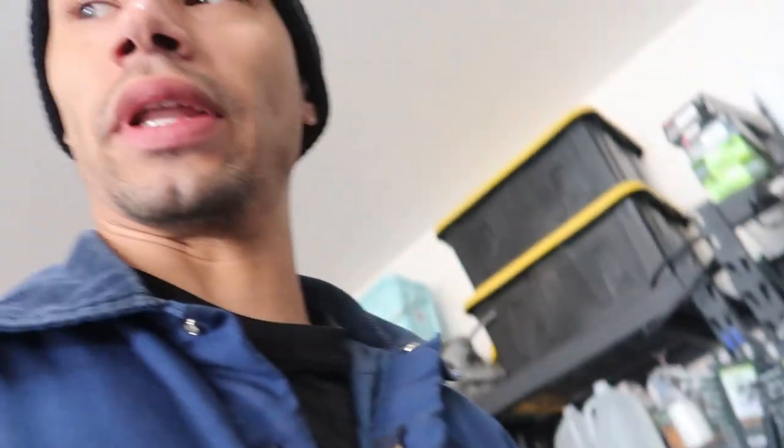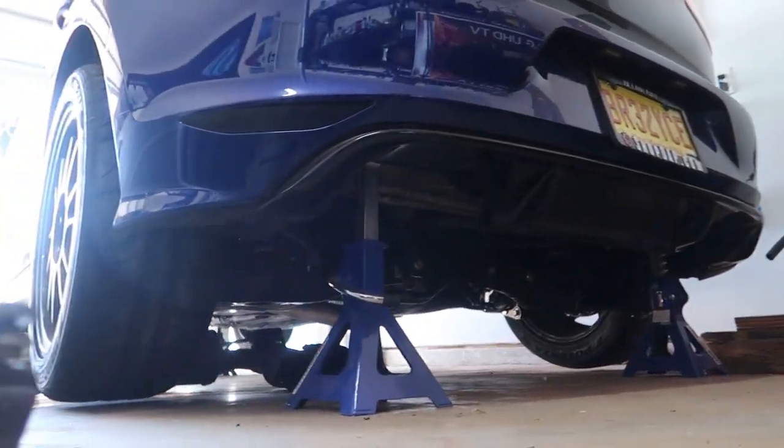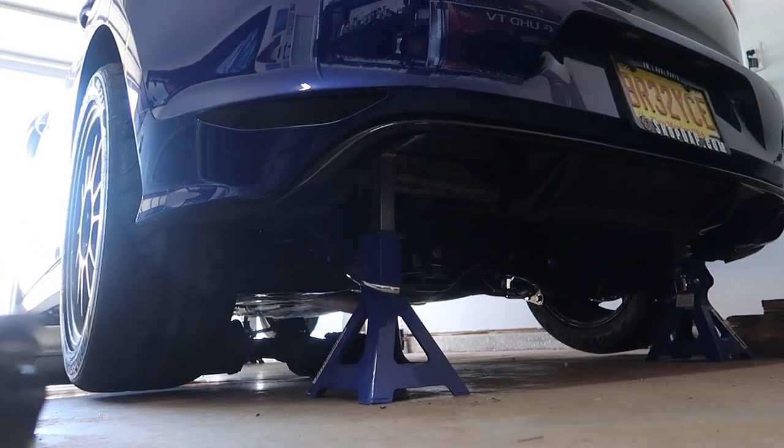It's been an afternoon here. Got the wheels on, re-torqued all the studs, oil in the car, bumper on - basically everything except the exhaust and the belly pan so I can check for leaks. I can't put the exhaust on right now because the jack stands are on the frame. I'm going to go ahead and start the car, make sure it goes into every gear and the wheels spin before I go through all the effort of getting it on the ground.